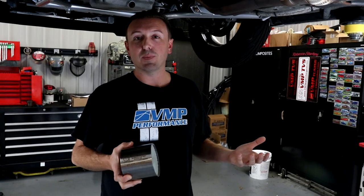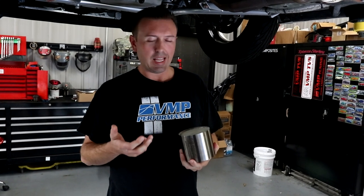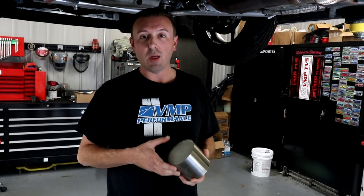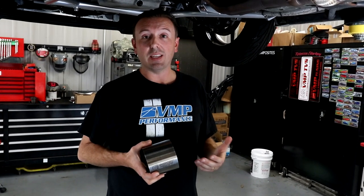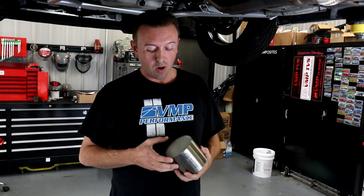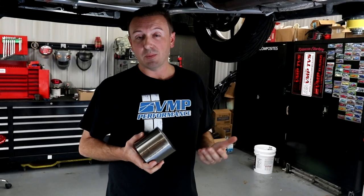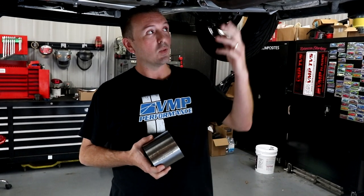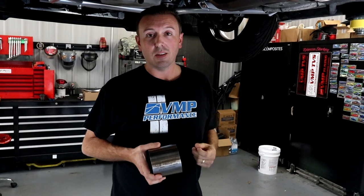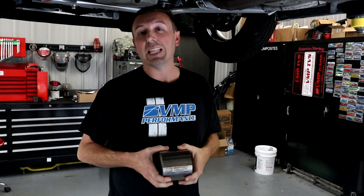By the way, Jesse is spelled G-E-S-I. These cats are high performance and very durable — they are designed for these types of power levels to live, not fail, and to still work. There are some things you have to be careful of: they still have a maximum temperature of 900 degrees Celsius, which is 1650 degrees Fahrenheit, which is why we had an EGT sensor in the exhaust. You do have to maintain catalytic converter protection in your tune to keep these cats alive and working.